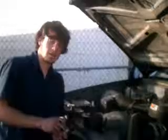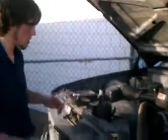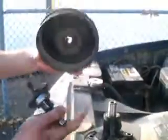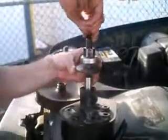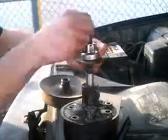So here's our power steering pump, fully rebuilt, studs and outlet fitting in, nice and clean, new seals inside. So we'll go outside and install it in the truck. Alright, so we're ready to install it back into the truck. This is another tool, it's an installer. It just presses the pulley back on the shaft and it screws in right here, so that's how it pulls it down.